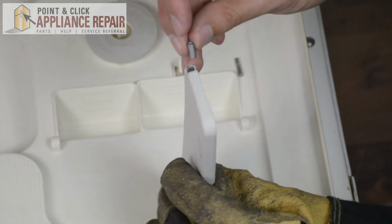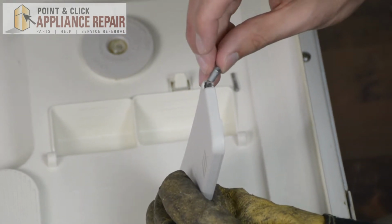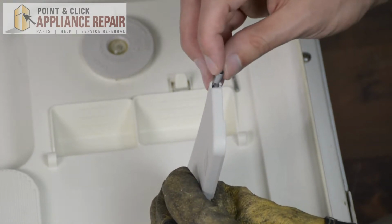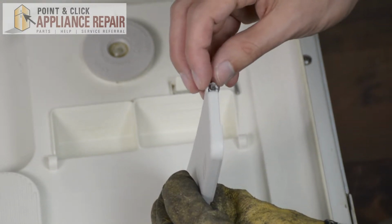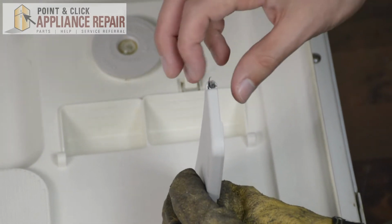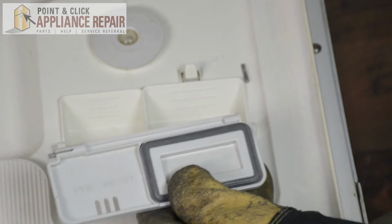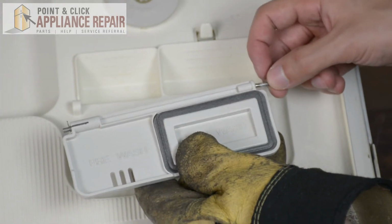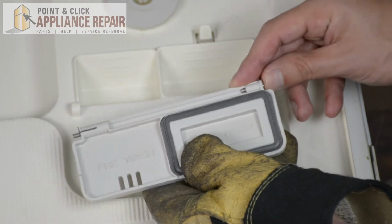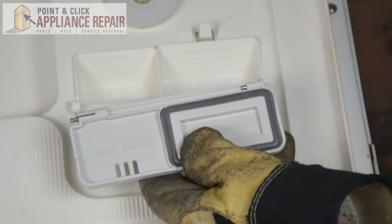And then the spring, and if you look on the top right here, there's a small hole where that small piece of the spring will go, so you know you got it lined up properly, and you don't want to give it any twists or anything to get the spring bent up inside of there. So now we can take the short pin and just push it in through this side, make it a lot easier, and we're just going to push it in all the way like so.